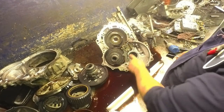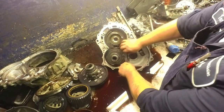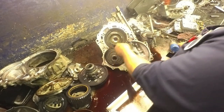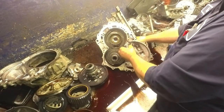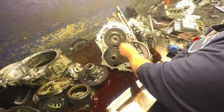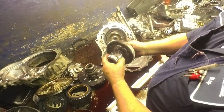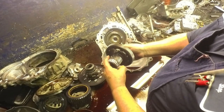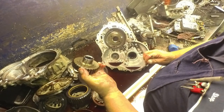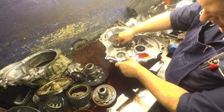Pull this little wire off and let it flip over there. Gets you a magnet — pull out your pin. Two 10s out here, get the pressure off of that, talk this out to park. Pull our pin up — park actuator and our spring. Make sure all of our teeth are good here. Looks good. Here's that hub that clips on that snap ring — looks good. You can leave this in there; just make sure none of your teeth are screwed up. There's no need to take this out of there.